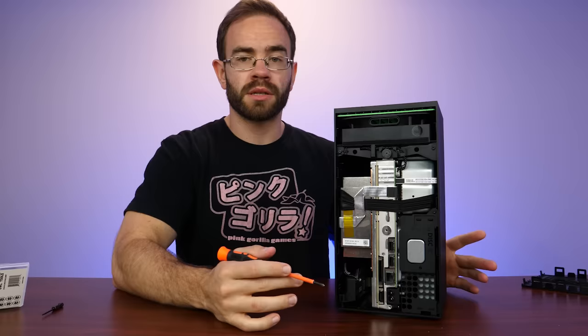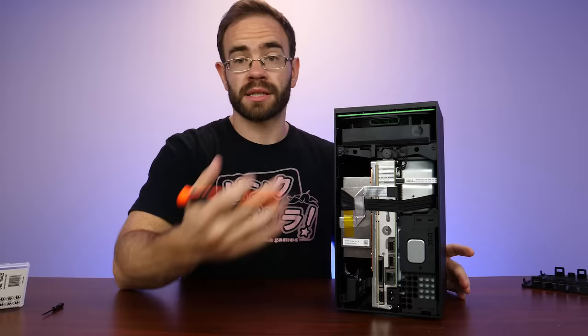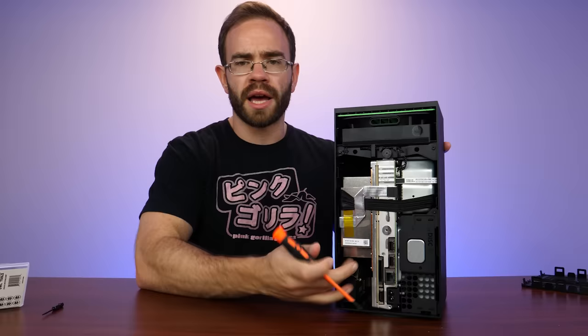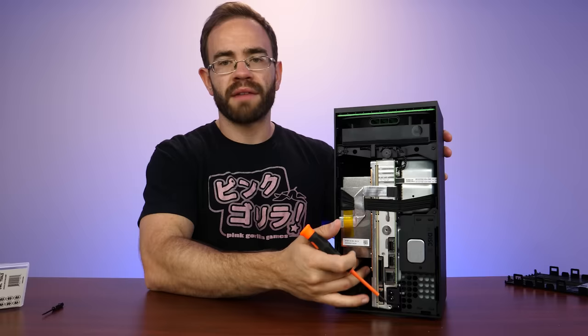One thing I've mentioned with systems when it comes to overheating problems is generally that dust will get caught on the other side of the heatsink — the side you cannot get to most times because it's completely enclosed inside of the system. They would use a fan shroud to try to funnel air through, but that's where it would pile up. Fortunately, it looks like where we have that opening on the bottom, you do have access to this side of the heatsink.